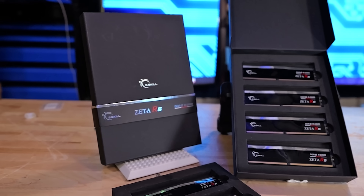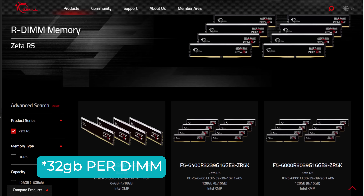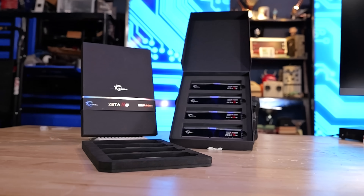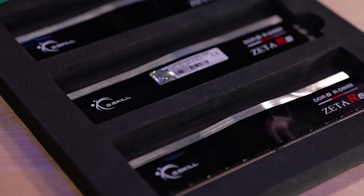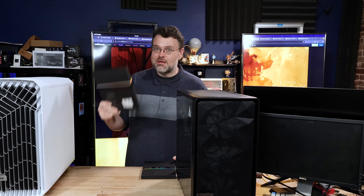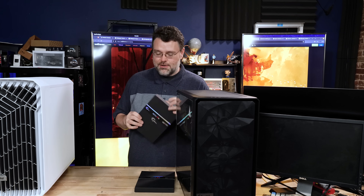Yes, because this is their 32-gigabyte kit — this one just entered the market. There's 256 gigabytes of lovingly hand-binned DDR5-6000. DDR5-6000 is nothing new, but this is, because it is registered error-correcting memory. Registered error-correcting memory in a desktop system? Yeah, it's more likely than you think. The first platform to support that are these Xeon W systems. G-Skill puts on their box Xeon W 3400 and W 2400. The thinner box has four DIMMs; this thicker box has eight memory sticks.